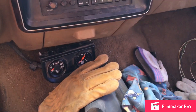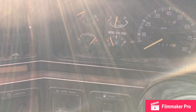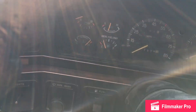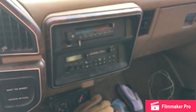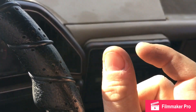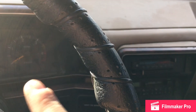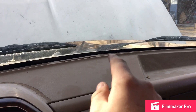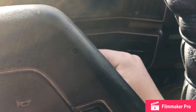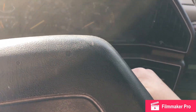I don't know if this has the factory radio. Between the two fuel tanks and everything - I'll put in another part where the fuel leak is - it's the fuel selector from the two tanks joining together. It's sucking in air right there, and I'm betting it's sucking in air from the fuel filter too. So it's leaking around there also. That's how I start the truck, and it gets really annoying.